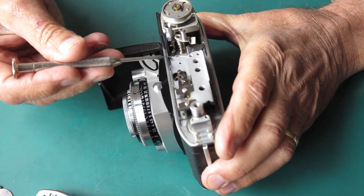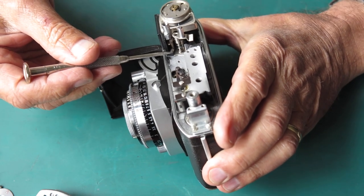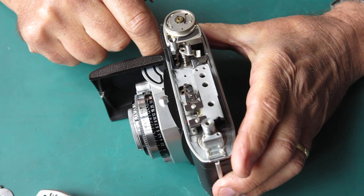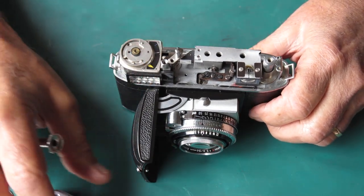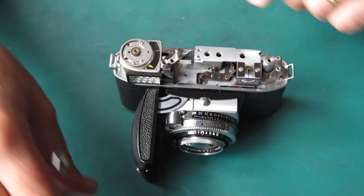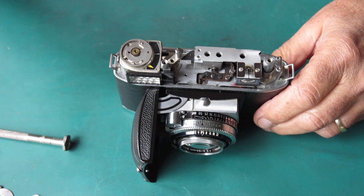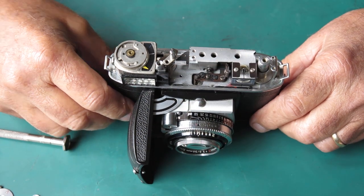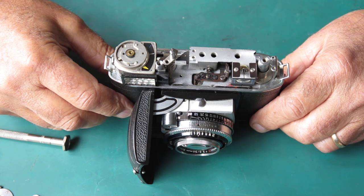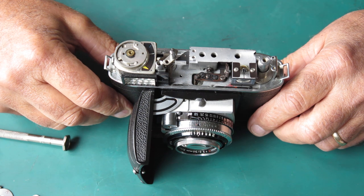On this camera there's a screw that holds the meter in position - often that tab is broken off. If you just rip the top off the camera with or without the dials, chances are the meter will lift straight off, snapping that little tab off. Then things will not be fixed as firmly as they should be later.